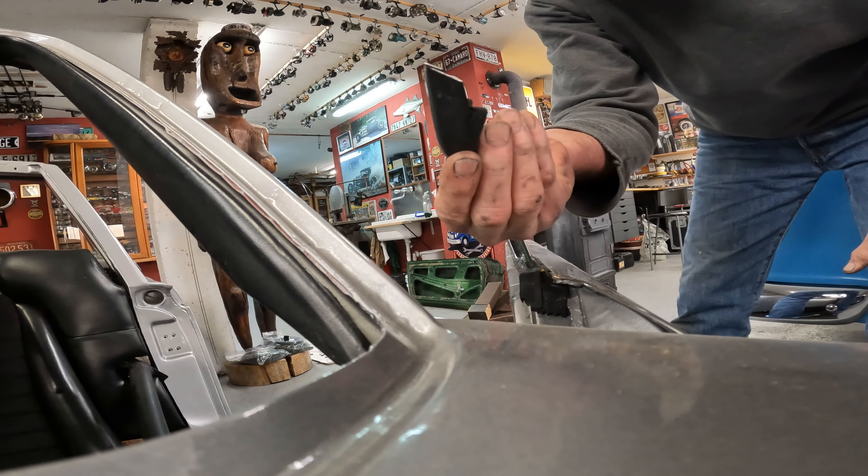Long story short, I played around trying to get the Chevy fuzzies I had left over from the Nomad to fit in these tracks — booged it all up, just worth a try. But anyway, these are the fuzzies right here — the outer window fuzzies from 914rubber.com — and as you can see, the shiny side goes up, and they basically slip right in here. These were a pain in the butt to get out, but I got them out and got them cleaned up. There's also a seal that goes into this outer track up here. I've got all new parts and new rubber — this is all lubricated up, the windows are clean and protected. And again, three weeks later, in the garage on the 30th of December, I've got this disassembled. But now since I've done this about four times, it's a pretty simple process.